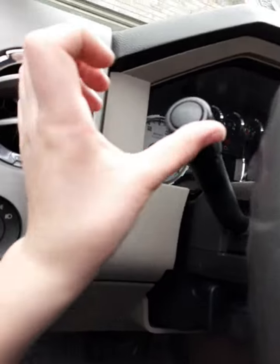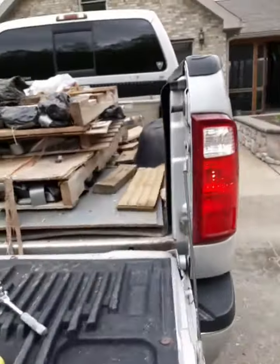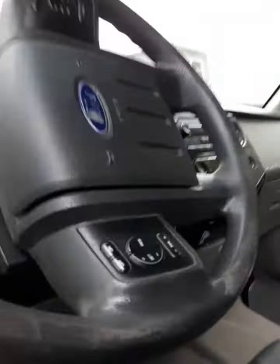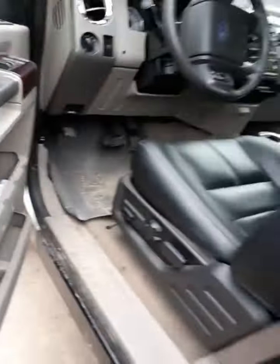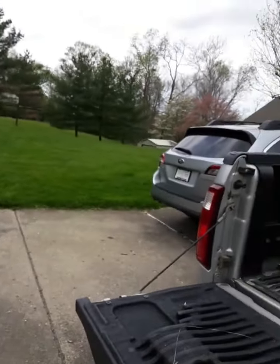All right, we got everything on. I'm gonna turn that blinker on over there. You can see it's on. And that, indeed, is fixed. I got another one for the other side too — we'll probably do that one sometime soon, it'll probably go out as well. So now you know how to change a blinker in a pickup truck. It's really the same with all pickups — typically you just got a bolt up top and a bolt at the bottom, and you just take them out. They're easy and small. So that's very simple. Thanks for watching. I hope you have a great day.